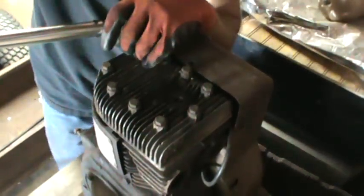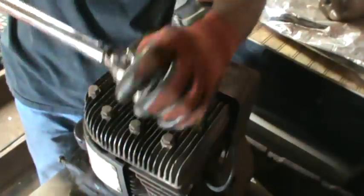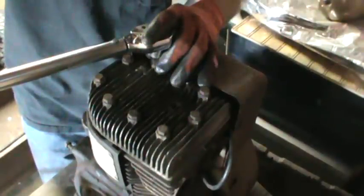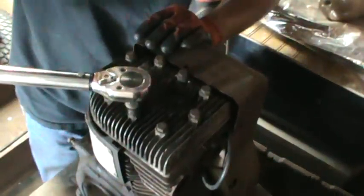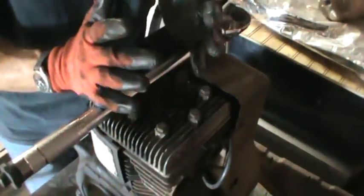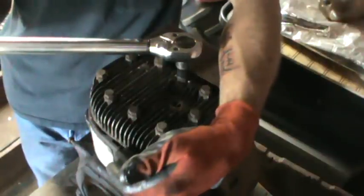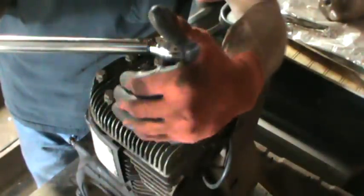Come back over to this side, there's my click, back over here. It's kind of hard because this engine's not settled down. Come back and just keep going back and forth until you get all of them tightened down. After you get all your bolts tightened up, run your engine until it is at operating temperature — 15-20 minutes — then let the engine cool and go back and re-torque. If you don't re-torque, the head gasket is going to heat up and collapse a little so the surfaces mate better, and you run the risk of blowing another head gasket if you are replacing one that's blown.